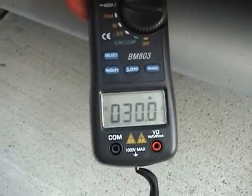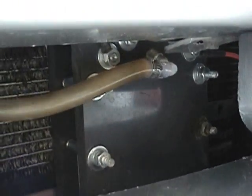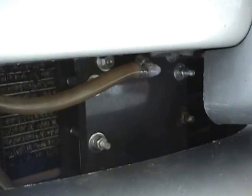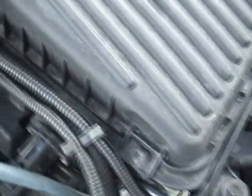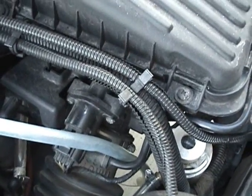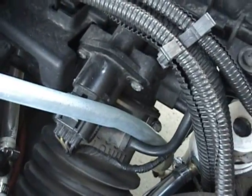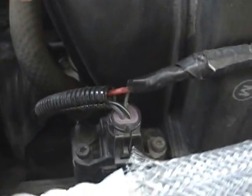For anyone just finding this on my YouTube page: this car is running a dry cell, located right here between the grill and the radiator. It's a 16-plate dry cell with 4 by 6 inch plates. The HHO runs into a reservoir, and from the reservoir it goes into the air box where the air cleaner is, with a tube going down to right up to the butterfly valve. The car also has a MAP enhancer hooked into the MAP sensor, which can be controlled from inside the vehicle to lean the fuel mixture.